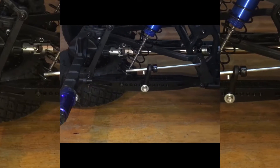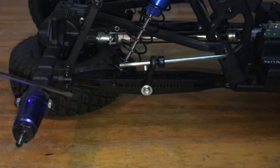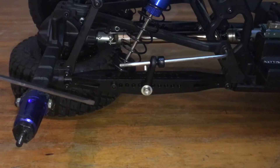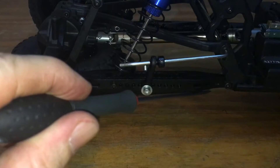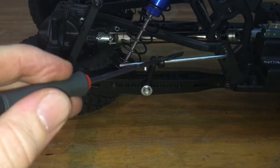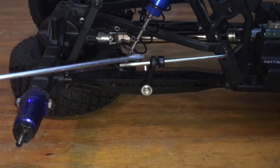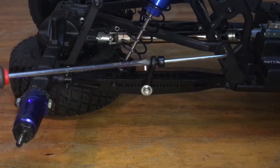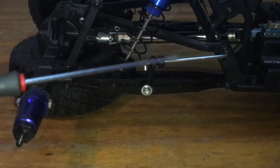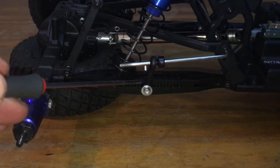The rear trailing arms can be regarded as levers. The furthest point away from the hinge point has the greatest influence over your sway bar - it's easier to push up your trailing arm at the rear than from near the front. However, there's a flip side: the rigidity of the stainless rod. We can set the bolt back in towards the shock so it has a greater influence on the sway bar, but the further along the sway bar the ball joint goes, the less rigid it becomes. So the less control it will have over the axle and your car. We have to find a happy medium - hence why I chose to put mine midway on the sixth hole as a starting point.